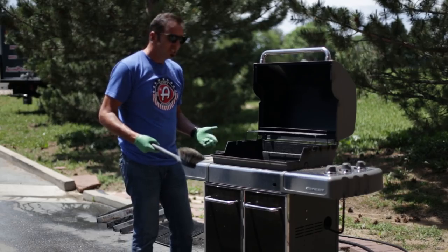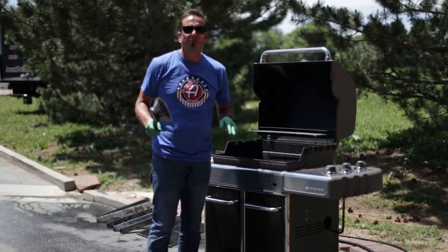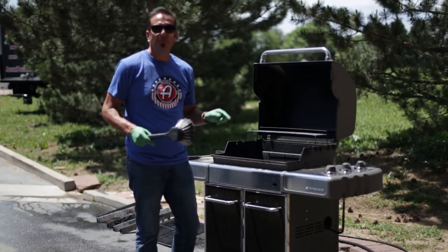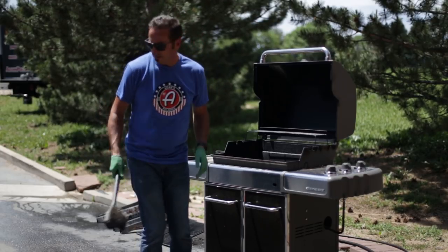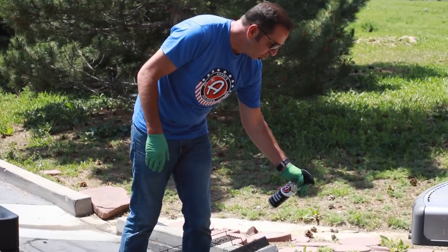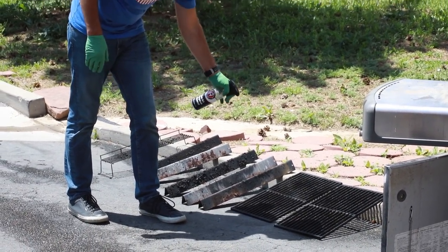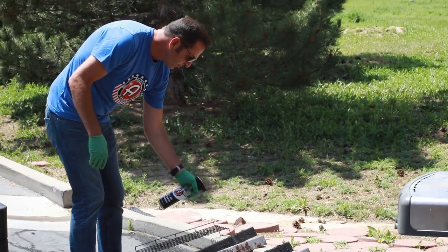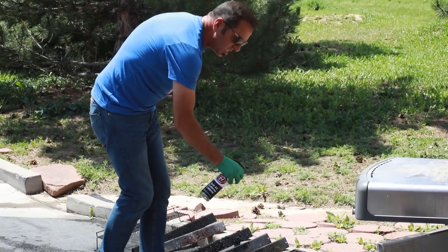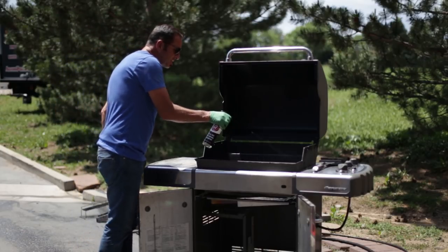If your stuff is stuck on real good, you've got to blast it out. Make sure you blast it out in an area you can easily clean up — sometimes on the lawn, sometimes on the street. Bottom line: blast out those old food particles before the grill is cleaned. I want to soak down the actual food-touching grill parts and the grates with eco APC and let it work for a few minutes while I do the rest of the grill.